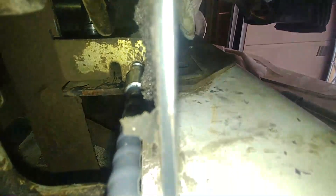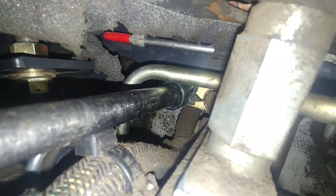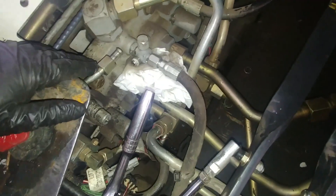Now we're starting our installation process. Keep watching because I will cover important parts on how to adjust the cable — this is important to make sure you have proper acceleration. I placed the cable in the bracket — it's the second slot from the bottom. My ratchet with the socket is still on that bolt. As soon as the cable got into that slot, you also need to match the notch on the cable — there's a little groove — and place it with the slot on the bracket. Then there's another little bracket to attach, same as we removed.